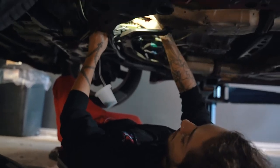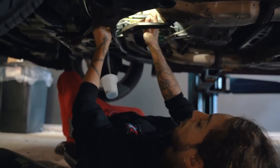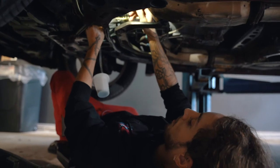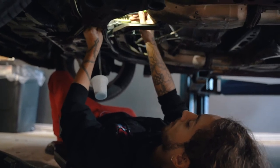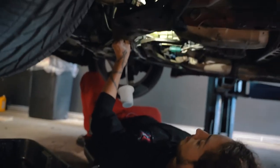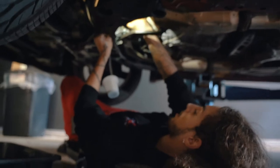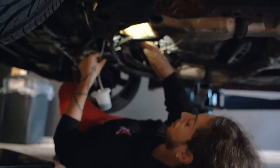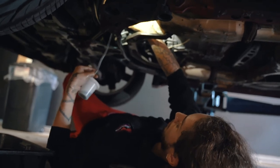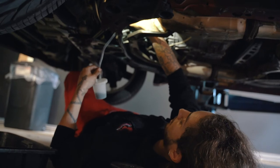So leave it down — I'm going to have her leave it down so it's pushing all that pressure out. And we're just going to crack this seal loose very lightly, not to where it's dripping, but to where we can sneak this little hose on and be able to crack it loose. Then you should see all this air start to come out — and the air is coming out. There's a lot of bubbles running down, which is a good sign.